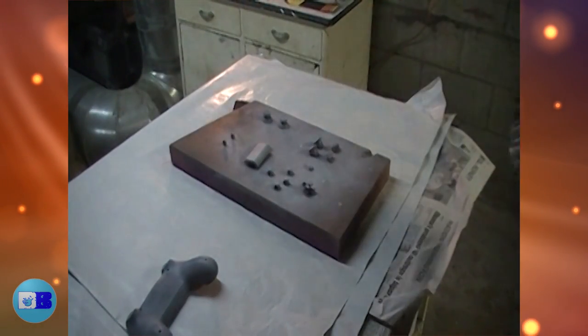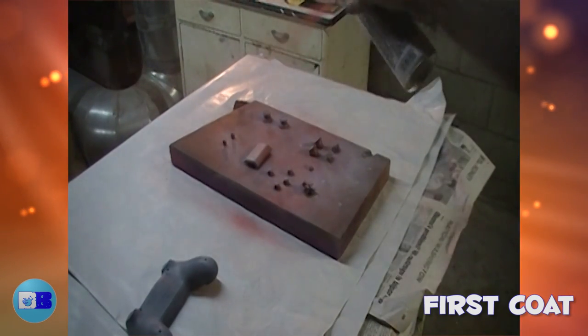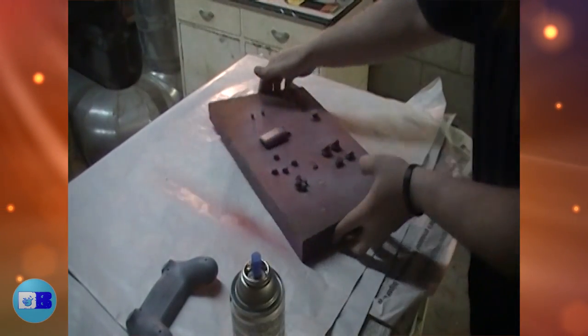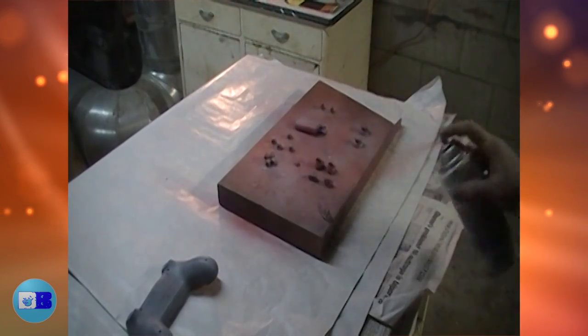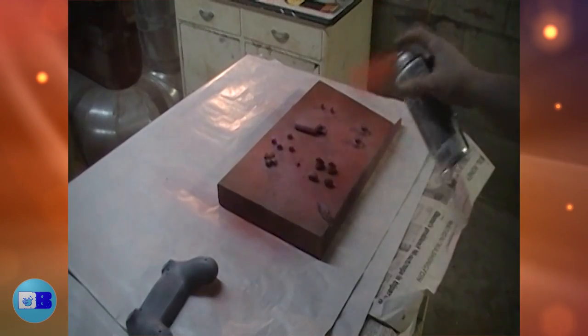For our first coat of paint, it is important that with a brand new can, you point it off to the side and spray it a couple of times, make sure that it's flowing right, and there are no drips and stuff like that. And then we're going to lightly coat our project once on all angles, very, very briefly, and only spraying within our sweeps.